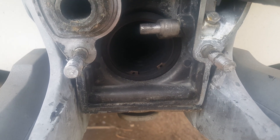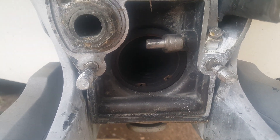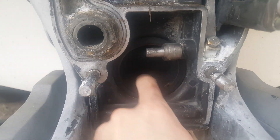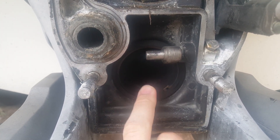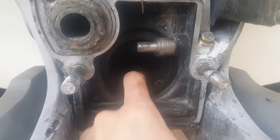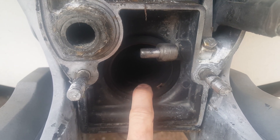This basically makes your ride as quiet and pleasant as possible. The only gotcha with the exhaust bellow is when you install a new one — you'll actually see perforations that need to face downwards, so that water collected in there will just drain down. This is not supposed to be watertight by design.